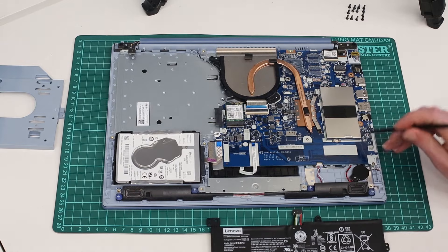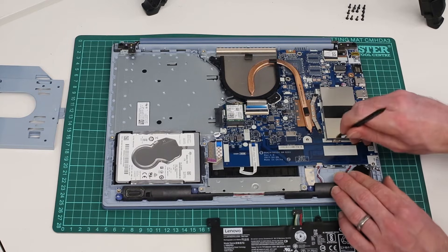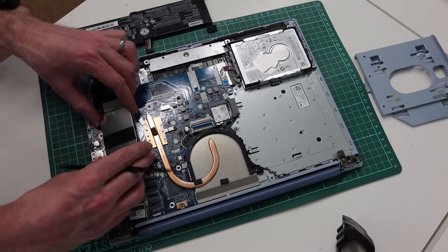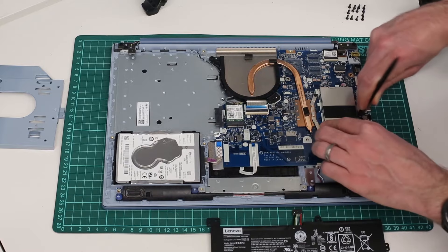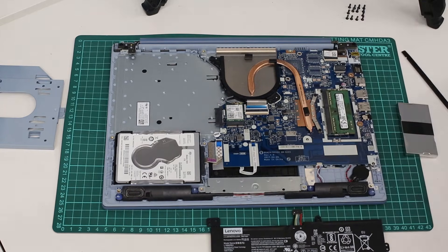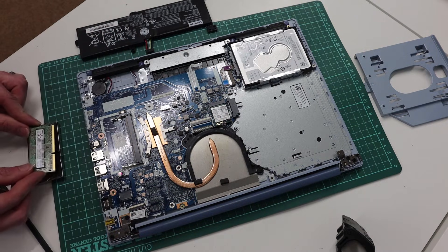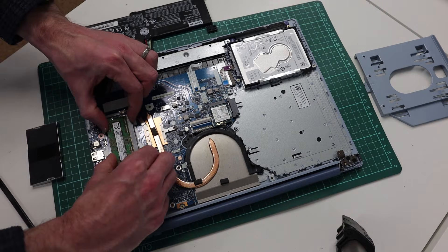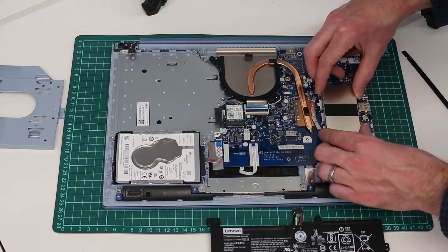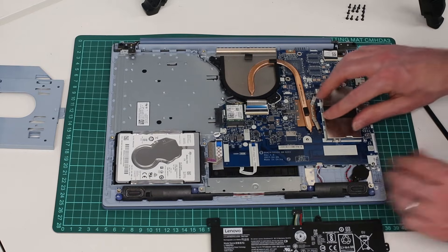Now with the battery removed, we also have the memory here. The memory is a single DIMM slot hidden under a shield. We insert our pry tool — there are little metal clips holding the shield on — and by pressing down on those we can release the cover. We then pull on the two clips on the edge and remove the module. In this case we are leaving the 4GB memory module as is, so we push it back down into place so it clips, and gently slot the shield back over.